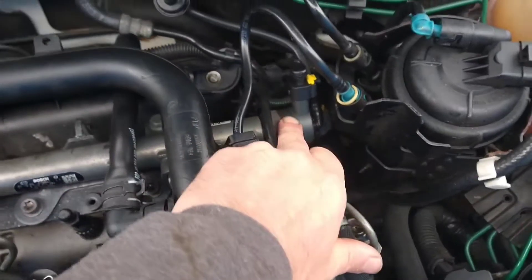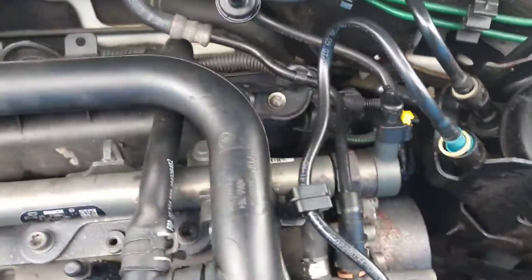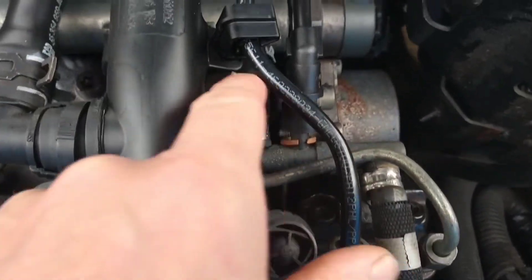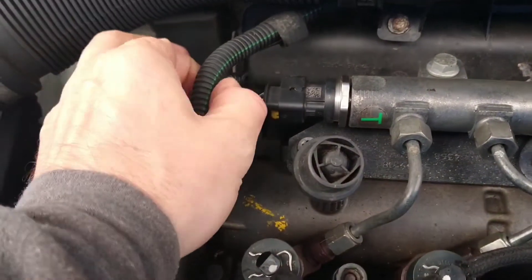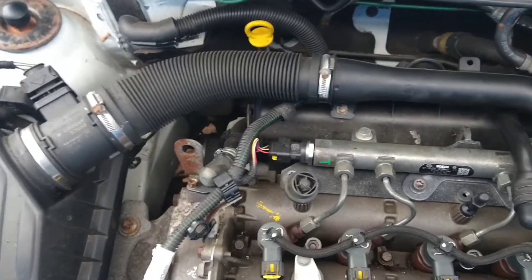If there wasn't pressure and plugging that up gave it more pressure, I'd have to look to see if that's being controlled — and if it is, then it would be that the valve was leaking. But I didn't go that way. This has already had a similar test: somebody's clamped the hose that returns the fuel. The return from this valve would return everything from the injectors into the same place — the leak-off. So that would have done basically the same test, just by clamping one pipe, to see if there's any change in pressure. But what I did notice was we did have pressure with a voltmeter here — it's just the scan tool wasn't updating it, showing zero pressure the whole time.